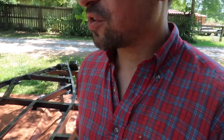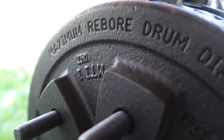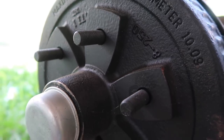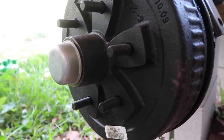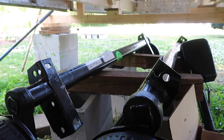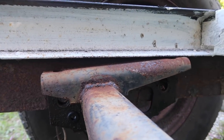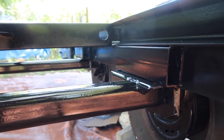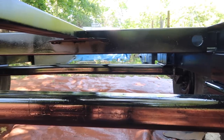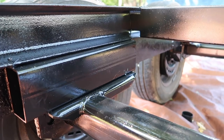Working our way down a little bit farther, we get to our new axles — these axles are so beautiful. We got these from Inland RV, an Airstream specialist in California with so many Airstream products. They ordered these ones for us from Dexter, and they're exactly made to fit our Argosy. Beyond just dropping them in, we added a three-inch lift. We put a block up under each of the axle plates, giving it about two to two-and-a-half inches. Inland RV also customized the shocks and the angle they sit at, giving us another inch of lift — so altogether we're getting around three to three-and-a-half inches of lift. The trailer frame is sitting so much more beautifully.